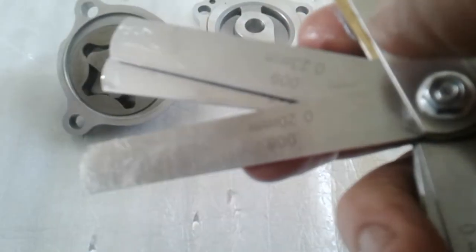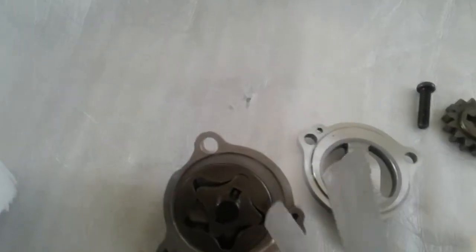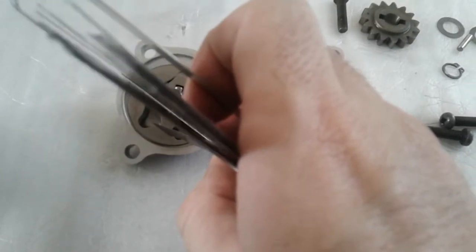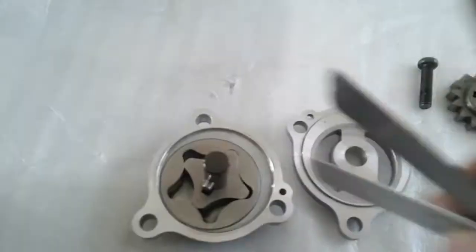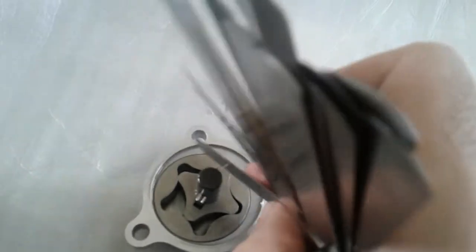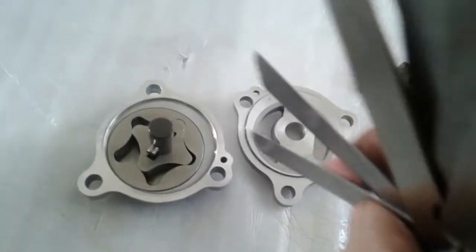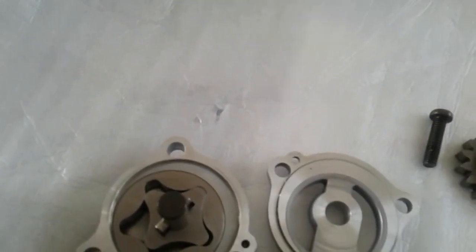You have to make sure there is no more than 0.2 millimeters of space between the inner rotor and the outer rotor. I measured it for all the combinations — four teeth, and each inner disc matched with one of the five outer positions. So I did it four times for each disc. If it doesn't go beyond spec, it's fine.